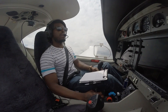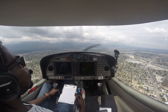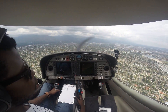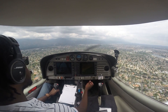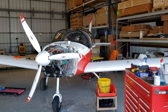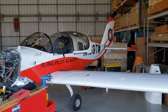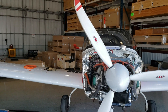But that's not all of it. The DA40 with the Lycoming engine only takes 100LL avgas, which averages $5 to $7 per gallon depending on location, while the Sling TSI will take car gas — premium car gas averages $3.00 to $3.50 per gallon. So you'd be spending significantly less on fuel with the TSI. For annual maintenance, a brand new Sling TSI might run a few hundred to $2,000 a year, while the Diamond DA40 runs about $2,000 to $3,000 a year — though a well-maintained used airplane shouldn't cost an arm and a leg.